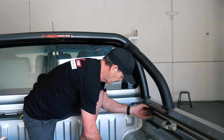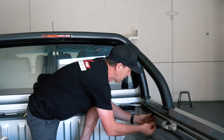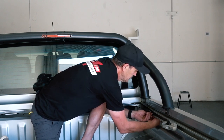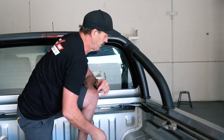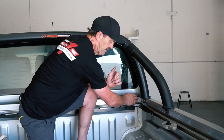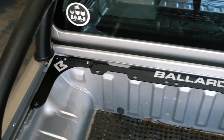In this case, we're just using the longer bolt, as mentioned earlier, and that goes through the side arm. Then again, another nylon nut on the back of that. This is part of the main strength of the whole unit, and also provides a tie-down point that's set further back — because if they're all up front, it makes it very hard to tie something down without being too loose. So by coming back, that helps. Then just repeat that on the other side.